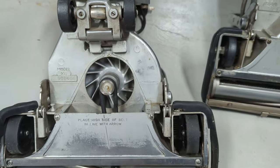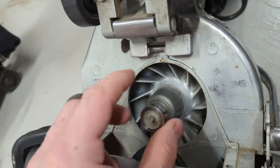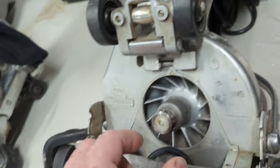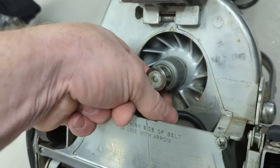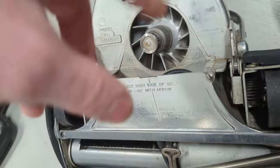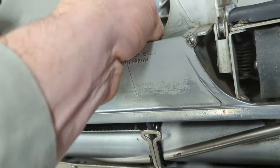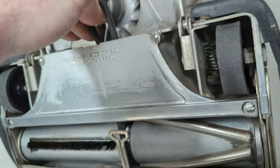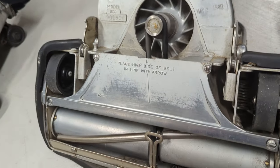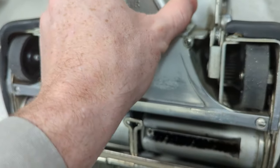The 900 and the early 925s had a clutched belt pulley. So this is the fan and the pulley, and you can see this is moving a bit. When the vacuum is running, it drives the belt just like a solid shaft pulley. But if you stall the agitator on this machine, it disengages, and then the motor just runs and the pulley releases. The clutched pulley was designed to save the belt in applications where things were getting caught on a frequent basis.